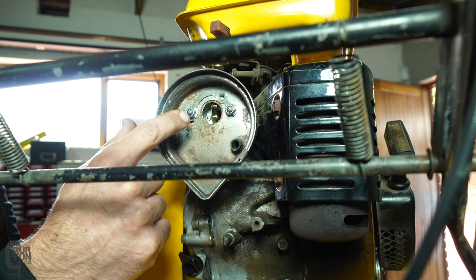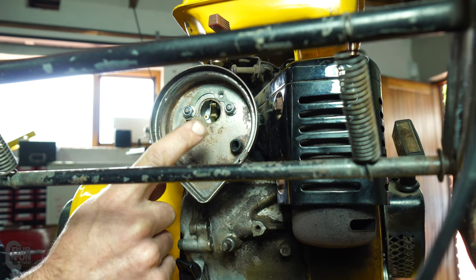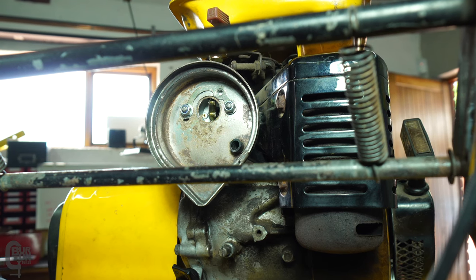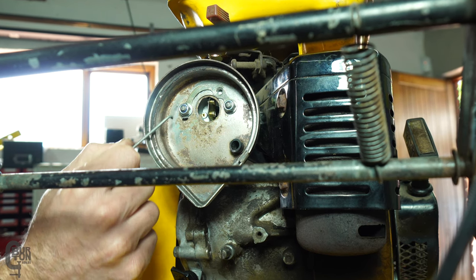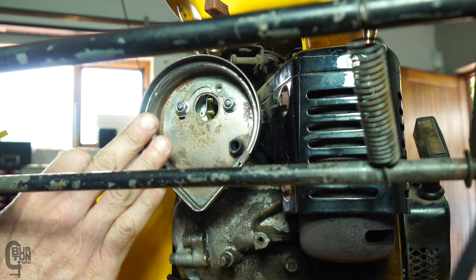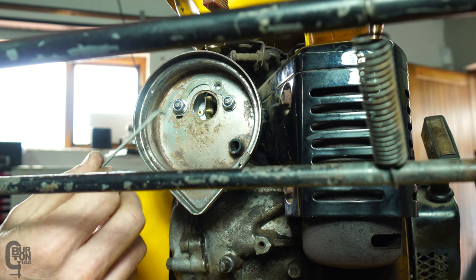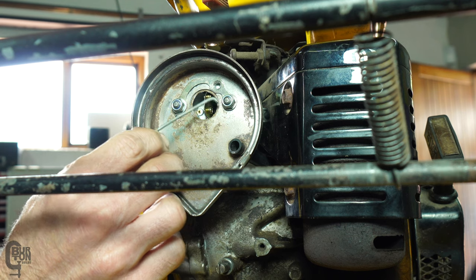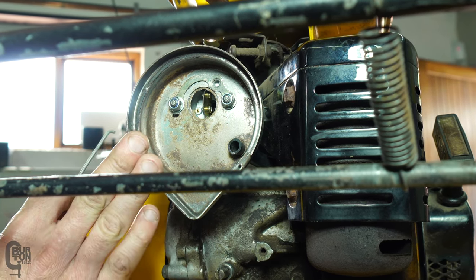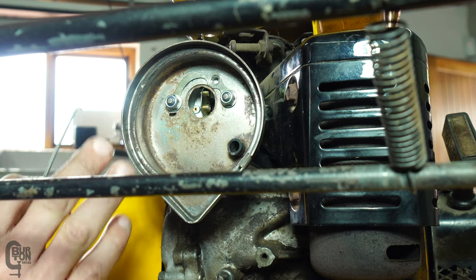What I've ended up doing here is installing everything back on. The new carb used the old gaskets with some fresh gasket maker. On this little retaining locking plate there are these little tabs - there used to be one there and one there, but those have broken off over time as the thing has been serviced and taken apart. So I've just put on some normal washers and then some nylock nuts. Hopefully those hold over time - we'll check at the next service.